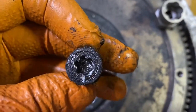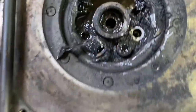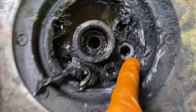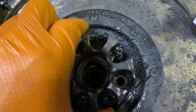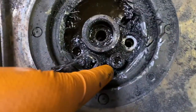This one I drilled a little bit, and the splines were still good enough that I could get the impact on it and it came right out - even though I'd tried many times with a breaker bar before. This last one I took out using the extractor tool. To get it in there I had to cut out the material around the bolt, which created this horrible mess, but it worked great.